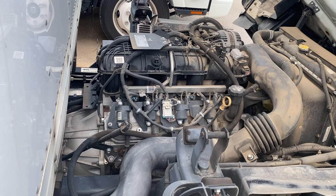I'm going to make a video on how to do a transmission service from beginning to end in the near future. The manual says to replace your transmission fluid every 52,500 miles, but pay really close attention to this fluid because heat ruins it — it burns it up. Your fluid may need to be changed sooner than 52,500 miles, so stay on top of it at those intervals.